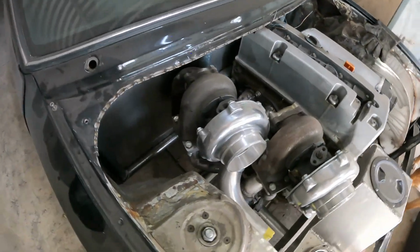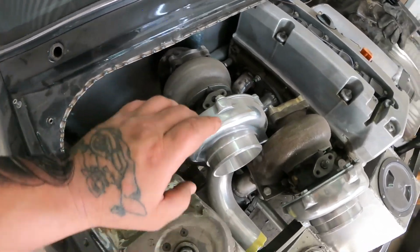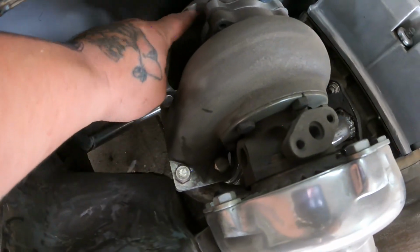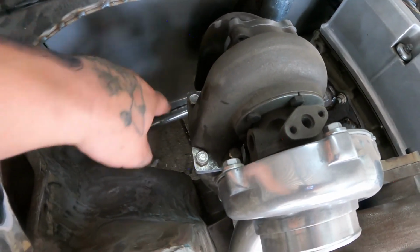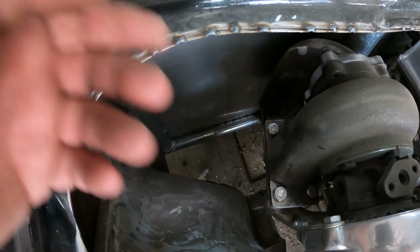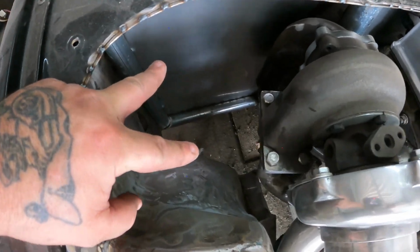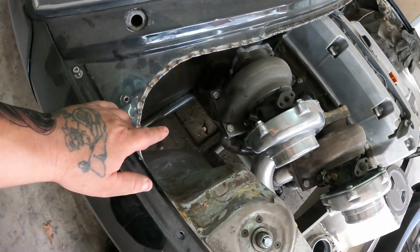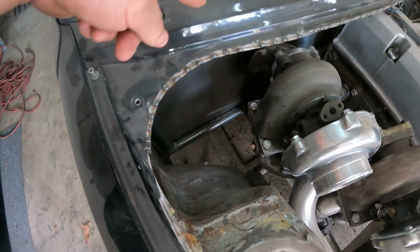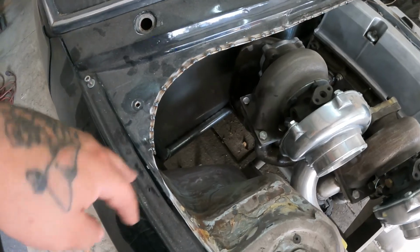The newest idea at the moment, and if you guys want to help me out, it's a bit hard, was to run it down here, 3 inch off the turbo. It's 3 inch off there now. I was going to do a Y here with an electronic exhaust valve, and a single 4 or even twin 3s coming up out the bonnet. When that's shut, it goes back down the whole way. I was going to do a single 2.5 inch exhaust, so that you could drive on the street, flick the switch and it comes out of here.